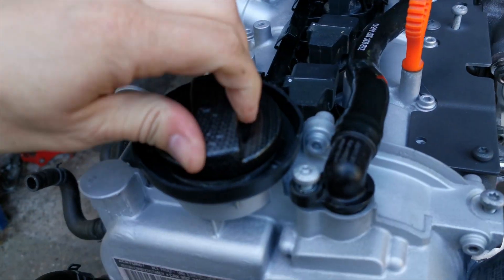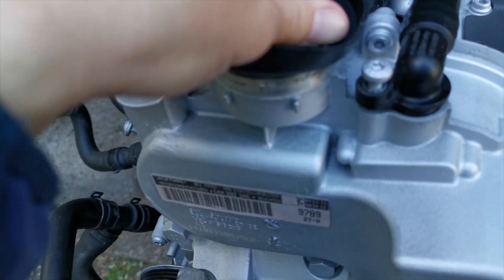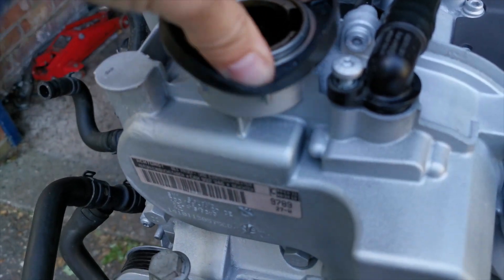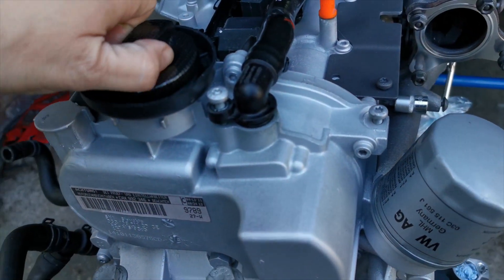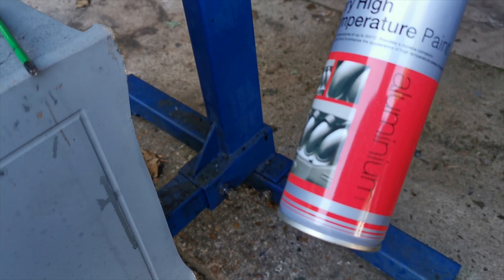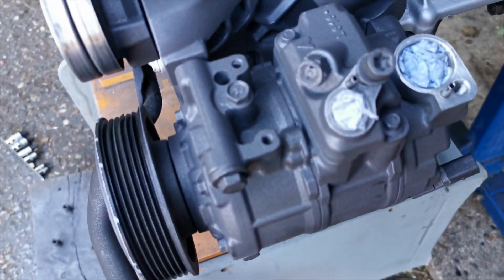Up on the top here is the carbon bit we dealt with for the oil. We took this off, cleaned it up with a good scrub in the sink, got it nice and clean, and then popped it back on. Trying to save you money — most of these things you don't have to replace, you can just clean them up. With the engine I've just gone over it with a red scotch-brite, didn't prime it, went straight on with the color. For paint, we used a Halfords high-temperature spray in aluminum — a silvery color — and metallic black which comes out like a gunmetal gray.